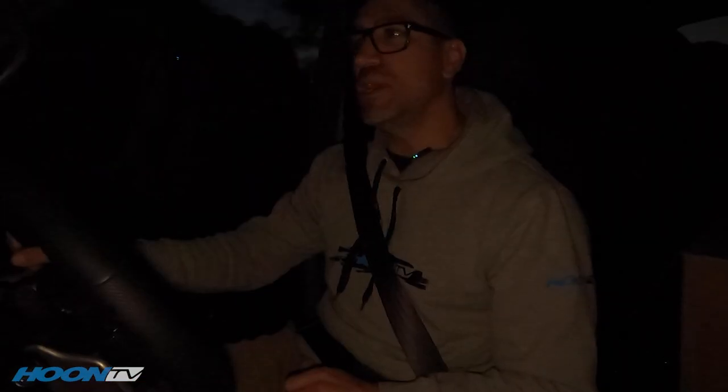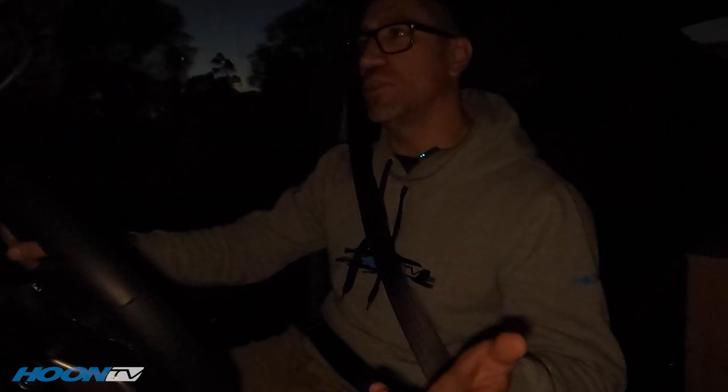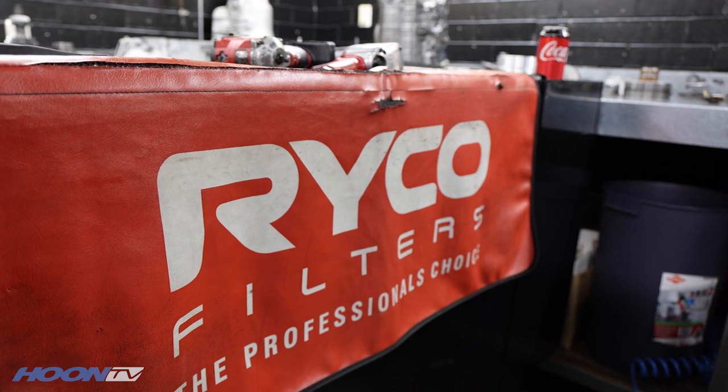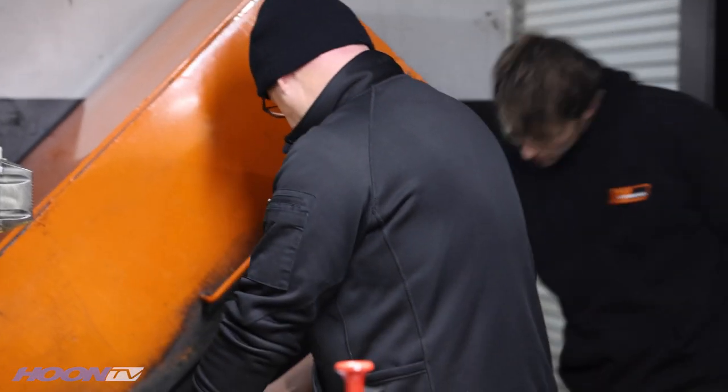I'm in the process of discussion with Mike up at MV Automatics — Mike's been doing my transmissions for ages, he did actually rebuild the trans in this car. It was a bit of a birthday rebuild. The one thing I'm suffering a little bit with this car is that because it's got a fairly choppy cam in it, it is quite surgy, especially at the lights and down low when taking off, and because of where the cam comes in power and torque-wise, you sort of lose a bit of that with the torque converter stealing it from you. We're probably going to go up to maybe a 2200-2300 stall converter, and then from there a few little upgrades with the internals of the trans to make it a little bit stronger, because there has been some discussion about maybe putting a supercharger on the engine.